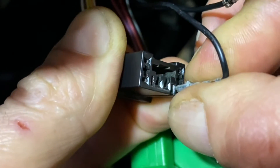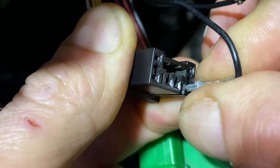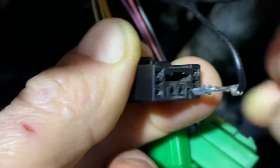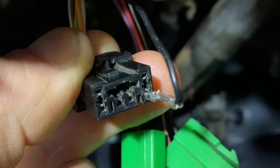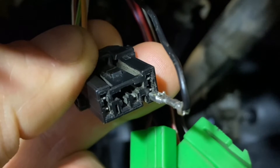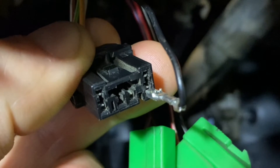Install it once and hold it for a second. Install it again and hold it for a fraction of a second. Install it again and remove it for the third time, then install it again and hold it. That procedure should have cleared all the fault codes in the ABS ECU. To verify, cycle the ignition and read the fault codes. The only thing that should pop up now is an 11 — that means there are no fault codes in the ECU.